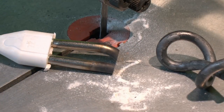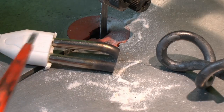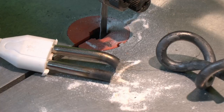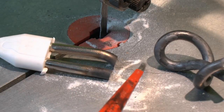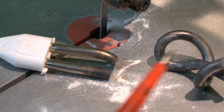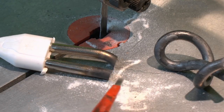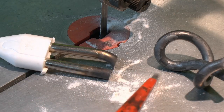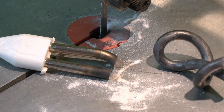And this is kind of what happens with heating elements in things like ovens and whatever. It only takes a tiny little flaw somewhere in the insulation — moisture gets in, the thing obviously degrades, and eventually it will short onto the outer casing and cause a fault. Certainly now with RCDs on pretty much all circuits, you'll find that normally it's the RCD that trips, because it's just a conductive path formed between the inner wire and the outer metal covering, which in normal appliances is earthed all the time.